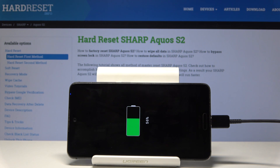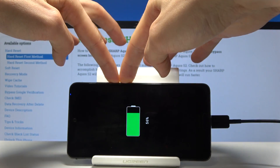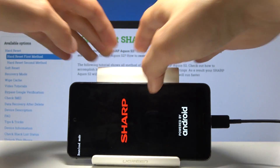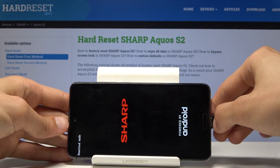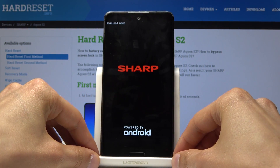Once the battery indicator is visible, what we want to do is hold the power key and volume down both at the same time. Volume down and power key, and immediately you see right here download mode, meaning that the device is indeed in the download mode.